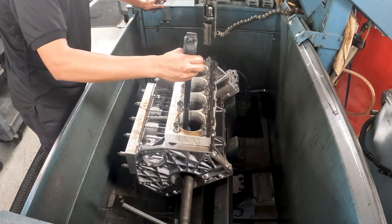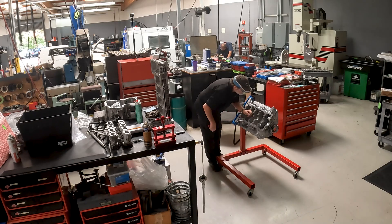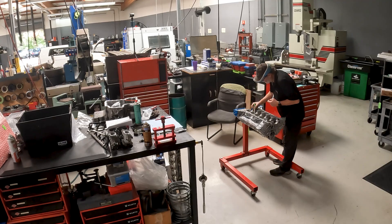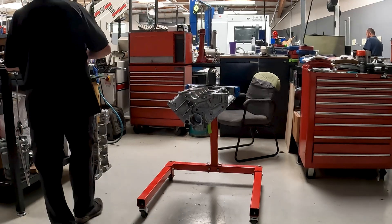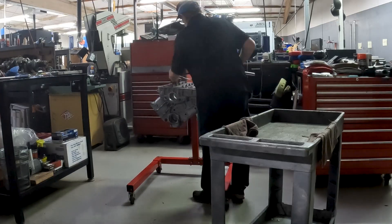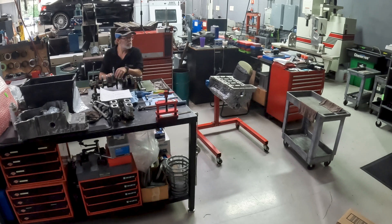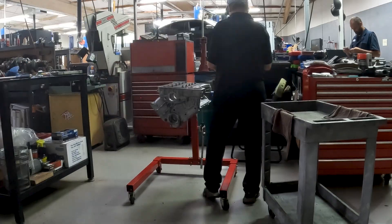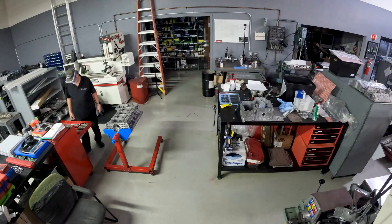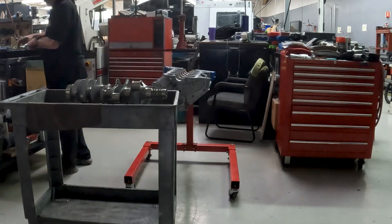The standard E92 GTS was a 4.4 liter S65 from BMW. We took that a step further with this 4.6 liter, which is stroked and bored and includes oversized forged pistons, a forged crank with increased stroke, and Carrillo connecting rods. It has a bore of 94 millimeter and the stroke is increased to 83 millimeter. In addition, common S65 failure points are addressed with Clevite Dynan Racing rod bearings and Carbon Autoworks valve springs.